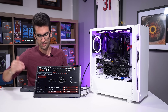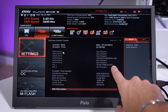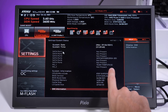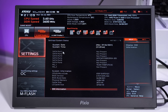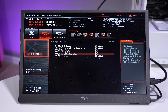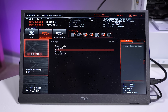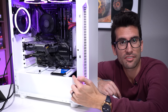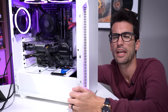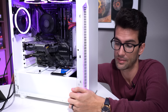Let's see if it sees the drives. In the BIOS device self-test, we can see both drives — that's a good start. It shows that the Team Group M.2 is connected into M.2 port 1. This might be a case of SATA mode versus NVMe config, but I can't find a setting to change that in this BIOS. Even with the two-and-a-half-inch SATA disconnected, the motherboard refuses to boot into the M.2. It sees that it's there, but it doesn't boot into it — which only happens if there's no bootable partition. I believe there was one at some point, but that he corrupted it.